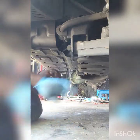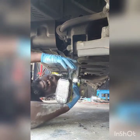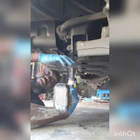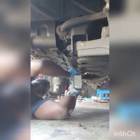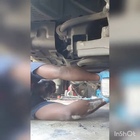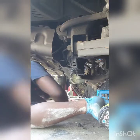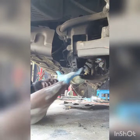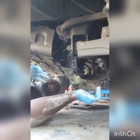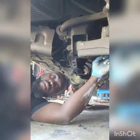Once you want to get access, there is a skid plate. You can remove it if you want to, you don't have to, but for me I like space, so I am going to remove it. It is 14mm bolt. I am using the cordless impact. Once you're done, you don't have to remove the front one — you can leave that. But you have all your space back here now to get to the starter to replace it.